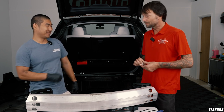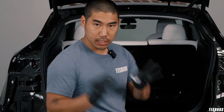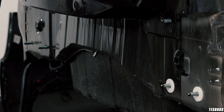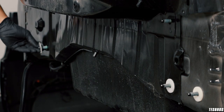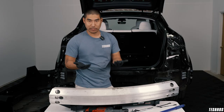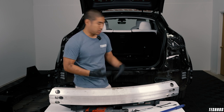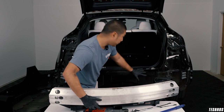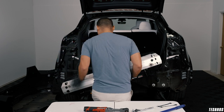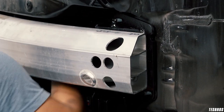In the instructions, what you want to do is put one washer on the inner hole and two washers on the outer one, and we're going to do the same thing for the other side — one washer on the inner and two on the outer. I'm not going to be pulling anything really with this; I'm literally just putting bikes and stuff on it, so this will be fine for me. But like Hal said, if you are planning on pulling, grab yourself some zinc and the grease — that's a much better option. Now that we have this set, I'm going to grab it from the middle and MacGyver it in.